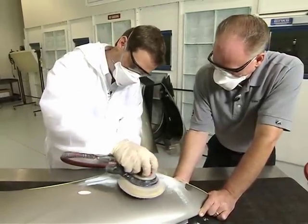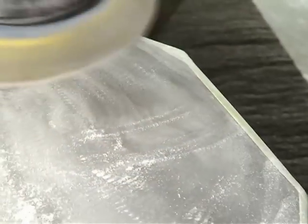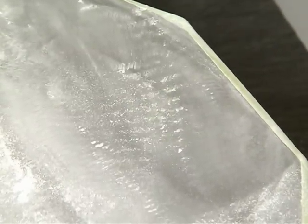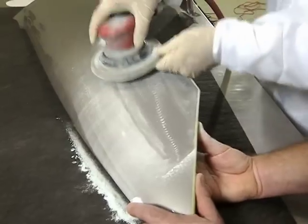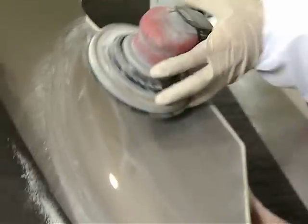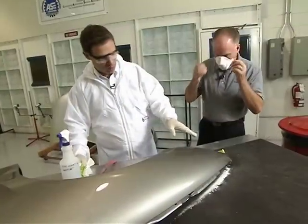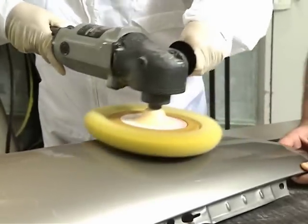Now is the 400 grit. Now I will make the switch to 600 grit paper. Now that I have the majority of the run sanded out, I'm going to get rid of the 600 grit scratches — transitioning now to 800 grit paper. Now 800 to 1200. Finish up with some 1200 and then we'll move on to 1500. And last, we'll finish up with 3000 grit with a little bit of water. Now we're ready for the buffing step. We've concluded with 3000 grit paper — we have a slight gloss. The buffer will bring up the rest of the gloss and the vehicle is ready for delivery.